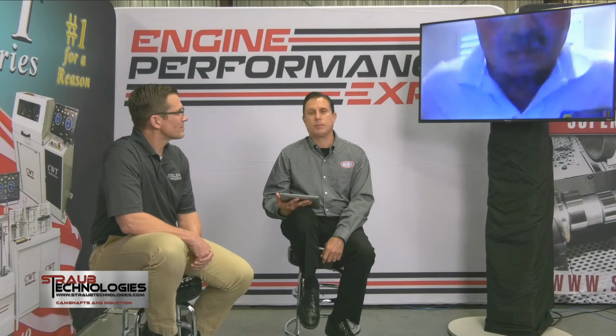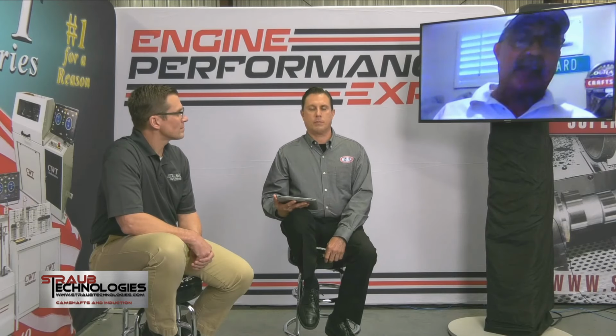What's better, upsweep or downsweep, and why when dyno testing? Don, that's your area of excellence. Well, we all do an acceleration sweep starting from low RPM to high RPM. We can do it either way, but the difference is that when you're starting at the low RPM, you allow the dyno itself to release the loader so that the engine will increase in RPM. Now, if you're doing the opposite sweep where you're starting at a high RPM and dragging the engine down, you have to remember that is going to change the force on that load cell. It's going to be greater when you go from high to low, when you're actually trying to stop the motor on the dyno. Of course, most of the good dynos will compensate for that.